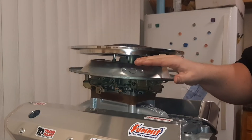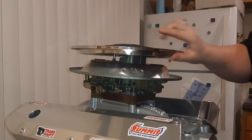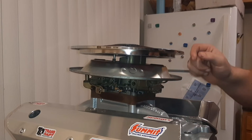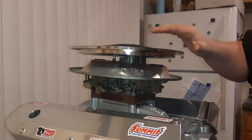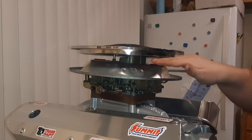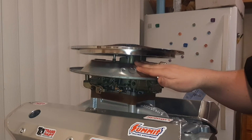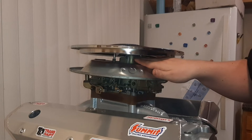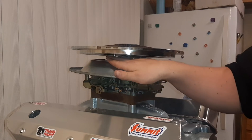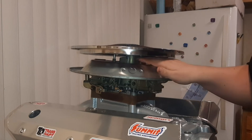As you can see, I have just removed the air filter element — this is at the exact same height as it was with the air filter installed. This is what's called a drop base air filter. It's really good for trying to keep the air cleaner low so you have hood clearance, but it comes at a very steep cost. Any air that's trying to get in has to run up against this, try to make its way up, then get bounced off that choke horn and not actually go down the primaries. It might make it down the secondaries when you floor it, but the primaries are getting essentially strangled, choked out.